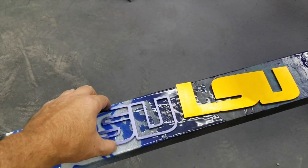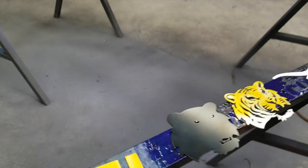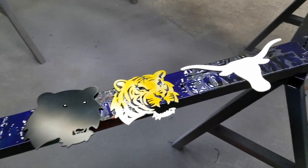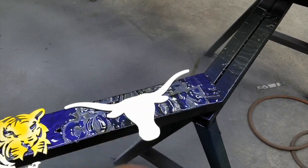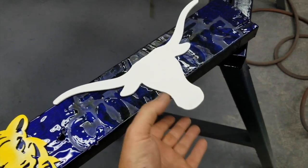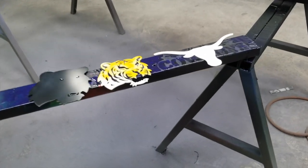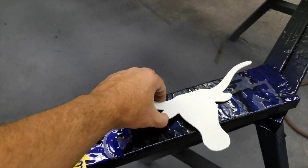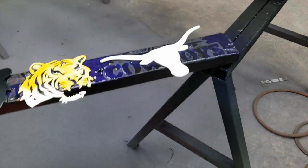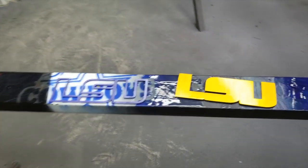So there's semi-pro tip number one. The second semi-pro tip: now that you have this little piece, how are you gonna join that together and make it stay? One of the common things in automotive painting you have to watch for is bridging across your masking — bridging across the edge of something. If I put four or five coats of clear on there like I normally do, the clear is going to bridge across all these edges and I won't be able to lift it off. Just about every paint job I bridge the edge on something — you have to take a little exacto knife and cut the bridge, because if you just lift it off it could lift the paint right with it.